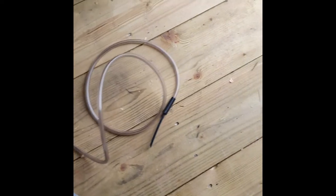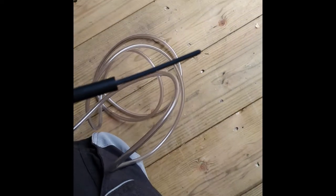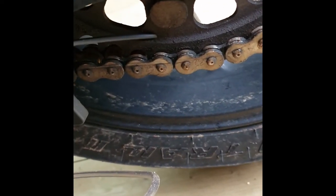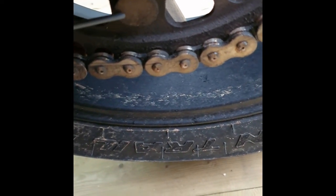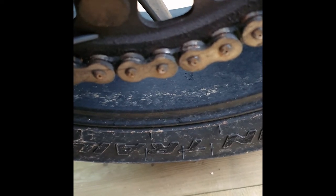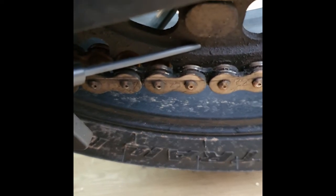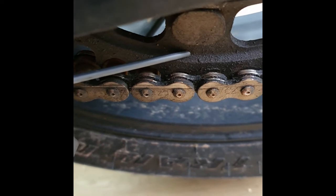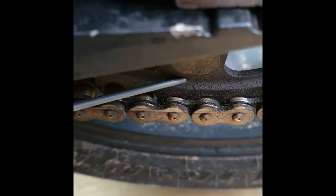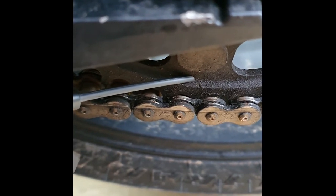On the floor here I have an unmanageable coil of pipework that comes with the kit of bits. The end here — that is the delivery tube that's going to be going onto the rear sprocket, just like that, and that is really important to note. You don't deliver down here or there — you deliver it in that tiny little groove just there, so that the oil gets dropped onto that and then centrifugally distributes out to the chain. With this single delivery side option, it does tend to deliver oil more onto one side than the other — that's not a major issue — but it just means you have to make sure you keep your outer chain links well lubricated, as this system will only lubricate the inner O-rings of the motorcycle chain.